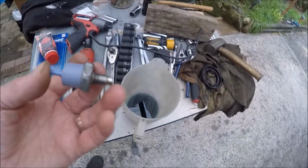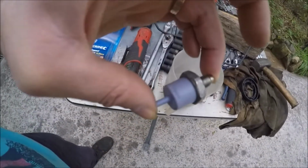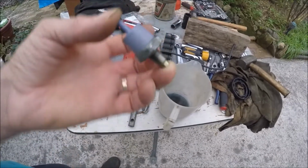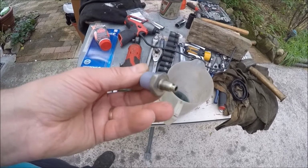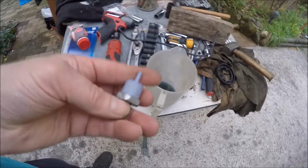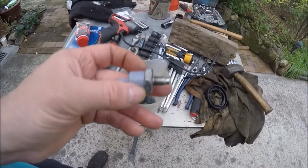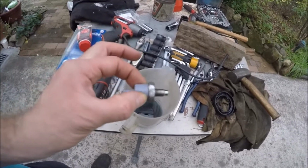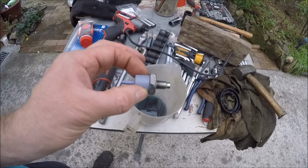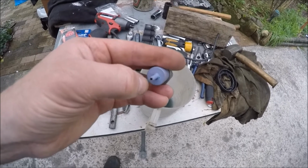and then I attempted to retain some of the kerosene inside it, and I just give it a bit of a shake, and then empty it out, and I did that several times. And then I continued to do some swirling. I went and started the compressor, and again I tried to retain or fill it with kerosene, and then I blew it out, starting this end.